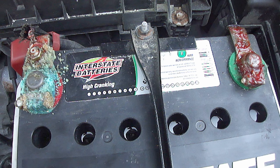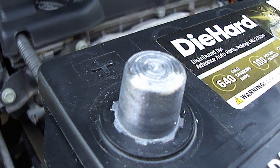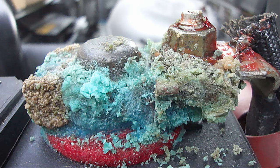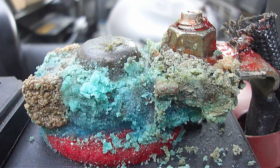I call this condition hyper-corrosion because it occurs very fast. The reason it occurs is very simple. When both regular and maintenance-free batteries are manufactured, the area between the terminal and the battery case are sealed with a bushing on both the positive and negative side. This bushing is what prevents hydrogen gas from escaping between the terminal and the case. Batteries are designed to vent hydrogen gas away from the terminals. However, if one of these bushings fails, this will cause hydrogen gas to escape directly at the terminal, meaning there will be a loss of fluid in the cell next to the terminal, and hyper-corrosion will occur at the terminal.